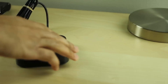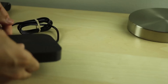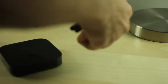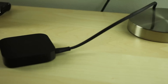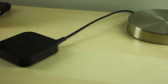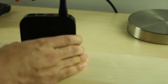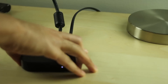Step 6: Now the hard part is done. We can disconnect the USB micro cable from our Apple TV 2 and remove it from your computer as well. Now we'll hook up the power cable and get ready to hook this up to the TV. You should see the light come on once it's plugged in. And now we want to hook up our HDMI cable, which goes right above where the USB micro cable was. Plug it in and then hook it up to your television.